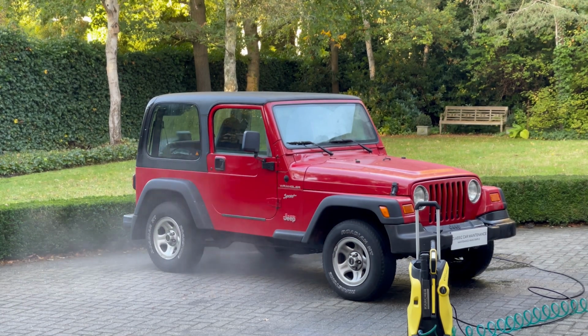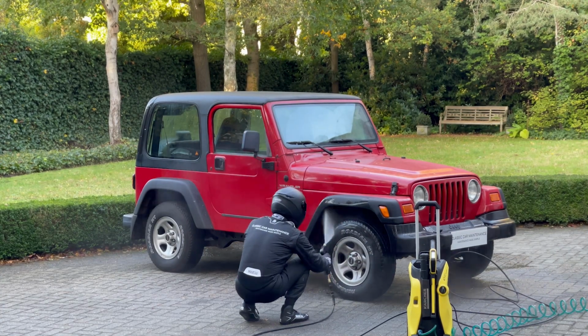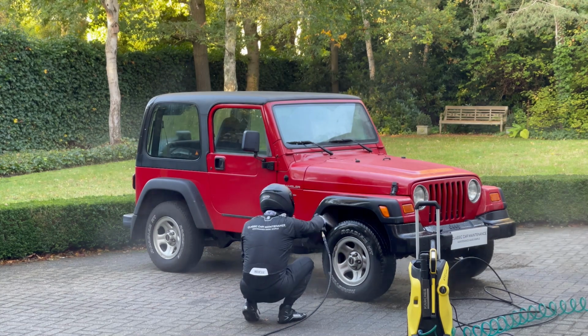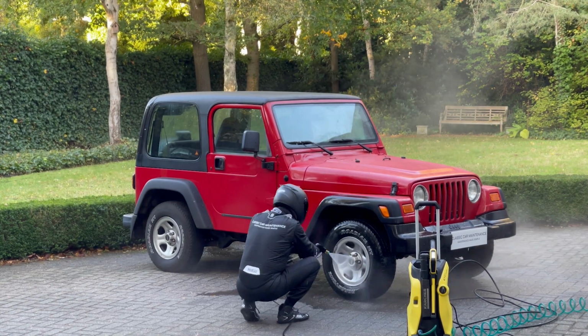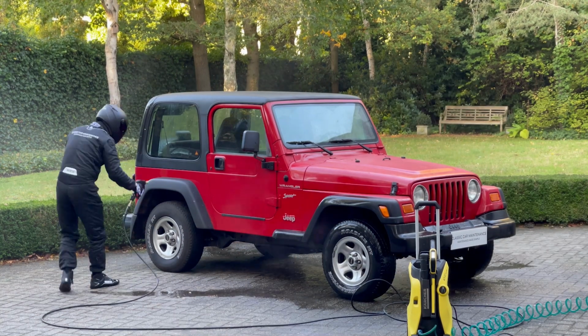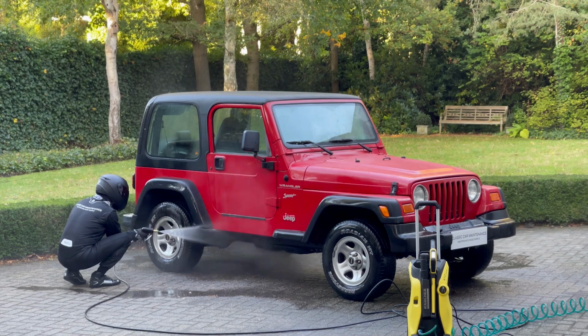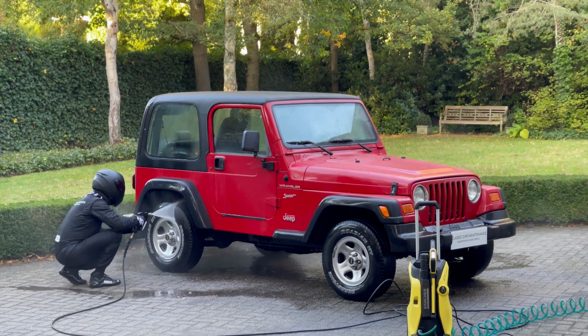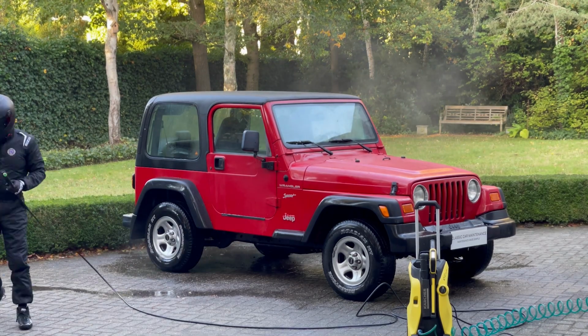We're using a stubby pressure washer gun with a narrow 25-degree nozzle to clean the wheels, tires, and inside flares. We like this combination best because the stubby gun is very agile compared to a long one, so you can work from the wrist. The 25-degree nozzle produces a more powerful water jet than a wide one, yet it is wide enough to work fast. You want to hold the nozzle about a foot away from painted surfaces. If you hold it too close, you might damage the coating. Work from different angles to get in all nooks and crannies.